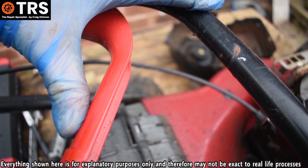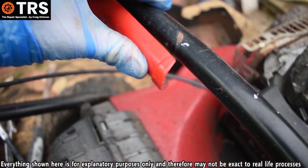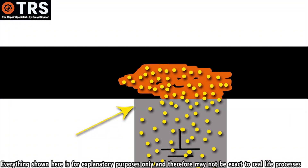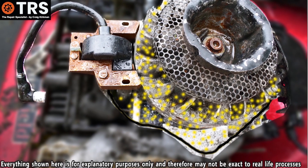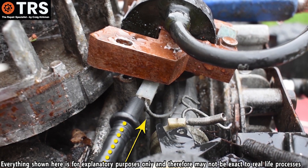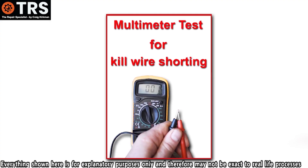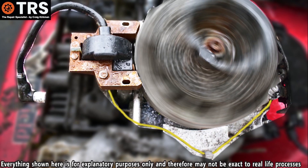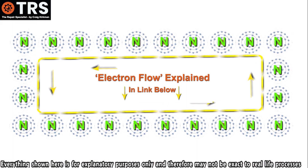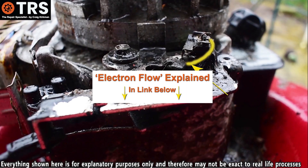In a nutshell, if the OPC lever is pressed and the buzzer activates during this test, it's likely there's a short in the stop system, predominantly in the stop wire. This may sound complicated, but I've put together a free printable leaflet on my website — linked in the description below — that shows the steps clearly. I really appreciate you watching through to the end. If you have any comments, please leave them below — I'd love to hear them. I'll be back soon. Thank you for watching.